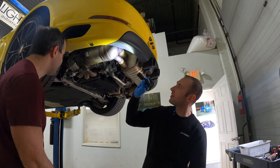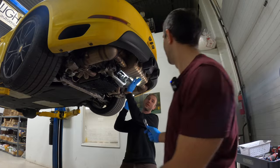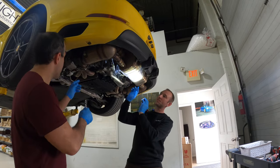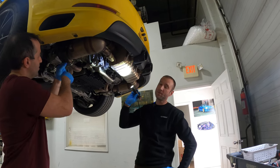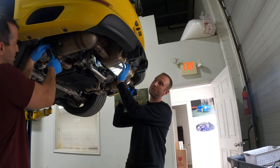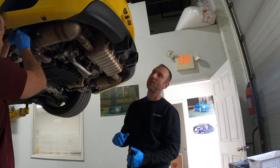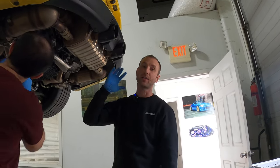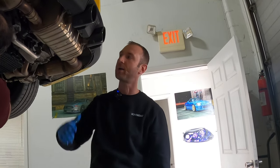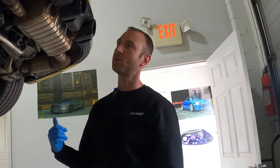I'm a little skeptical on the fitment, but we'll definitely try it. If not, there's only two straps holding on the center muffler. You've got the center muffler and then the cats on the side that connect to the turbo. Worst case scenario, we'll drop the whole muffler down. Some people remove the rear bumper for extra access, but you really don't need to — the bumper on this car is really just a skin or cover.